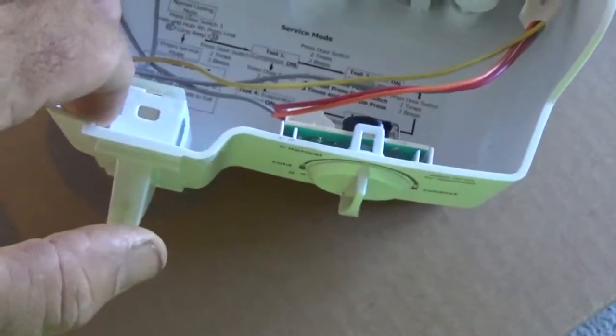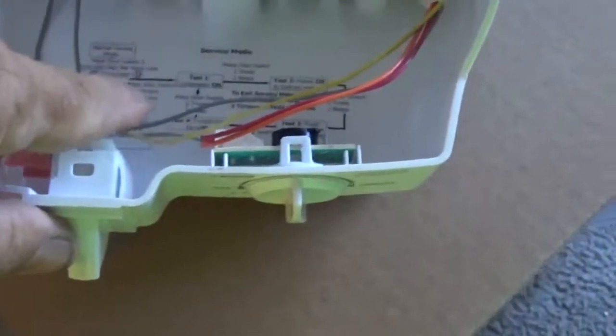Here is what we had before — this is your timer. What you do is you can stick your screwdriver up through the bottom here and adjust your timer; you can see that in other videos. Well, this new board doesn't have a timer deal on it — there's nothing there besides the hole for the screw. So you have to follow these instructions, which tell you to click it three times and hold it, or click it four times, depending on what the instructions say.